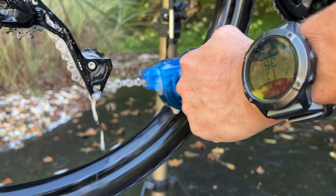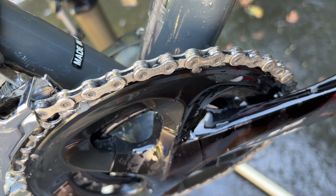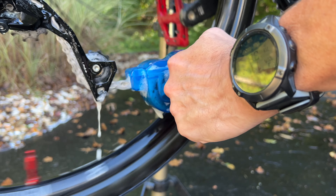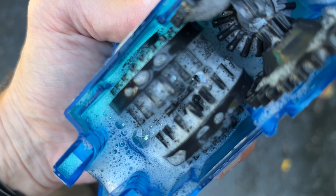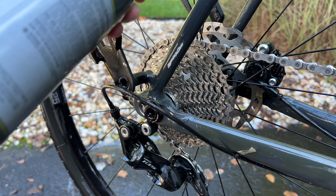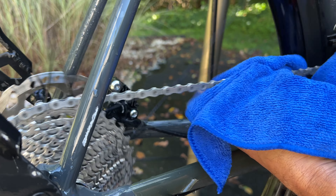I spray off the chain and use a clean towel or part of a clean towel to test how well it was scrubbed. This is where your personal preference is going to kick in. There's a certain amount of residue that even I can tolerate, but if it's still not to a sufficiently clean level, I just repeat the scrubber process again. The thing is, if you don't remove enough of the grit and grease, the new lubricant will not bind to the chain. So I have to say I'm impressed with the cleaner overall — this formula seems to work pretty well, and I'm also impressed with this little scrubber unit. It just feels a little bit more solid than what I had before, and I noticed that the inner brushes are in good shape afterwards. I'll clean this unit later before storing it away. So now we need to dry the chain. You can obviously use a rag, but I also keep a can of compressed air around to blow dry the drivetrain. Generally you don't want to apply lube to a wet chain.